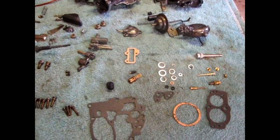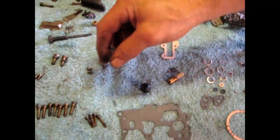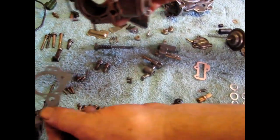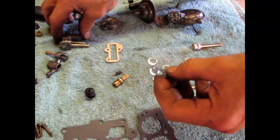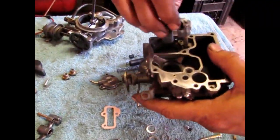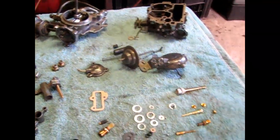I just want to show you the working parts like I explained in the earlier video. Let's start with the kits. First, you've got your top gasket, which is for the top. Then you've got your intermediate gasket, which goes on your base. You've got your choke gasket, which goes on there. Then you've got your power valves — these are the gaskets for them. First stage, second stage.